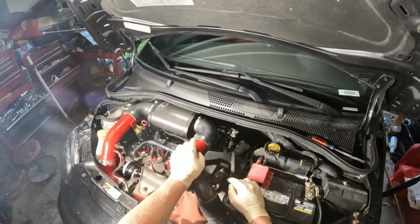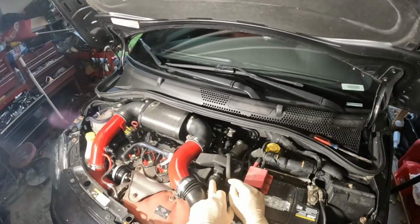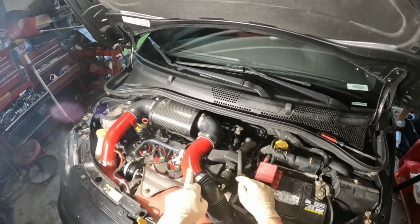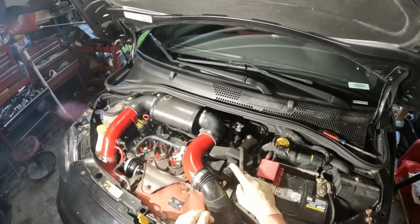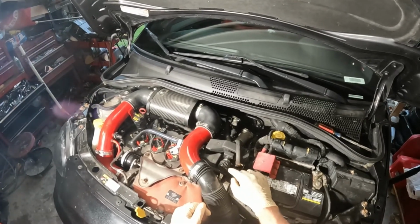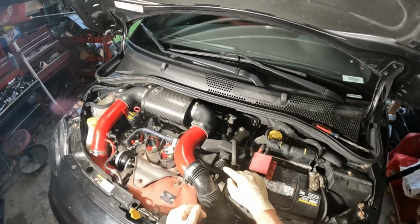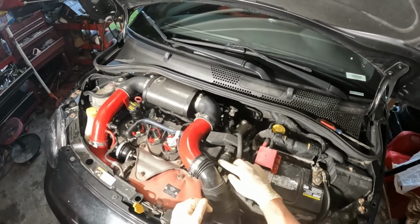So when you install an aftermarket intake, the hose that usually goes from your AOS vapor port to your intake, where the oils get put back into your intake track, gets taken off on a lot of intake systems, and then they tell you to put a breather on it. Well, you can see this breather has all kinds of junk on it.